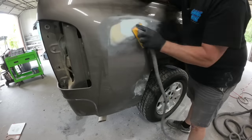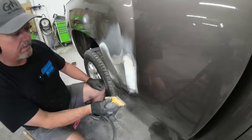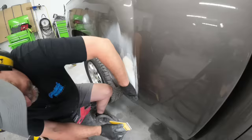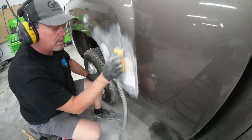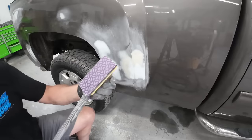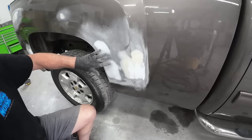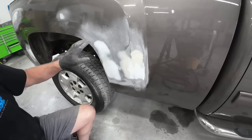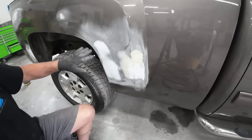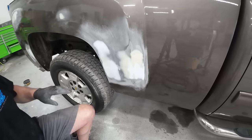Here I'm blocking over this icing with 180 grit sandpaper, and then once it's flattened out we'll block over it with 320. Now I'm going to do the final sanding with some 320 to remove those 180 grit scratches over the filler, then go around the edge with 320 to remove those 180 grit scratches, and then we need to sand this entire panel with 600 grit.